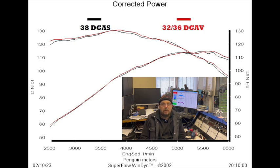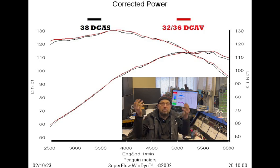Now, okay, some of you will go, oh, well, the engine needs a higher spec. It doesn't really make much difference anyway, because I've done this test on 140 horsepower engines and the difference was about one. So it isn't there. And some of you are going, yes, well, the engine can't make use of more carburation. Well, it can. Because in the next video, I'm going to show you this engine in the same spec, run on a pair of 40 DCOE series, and we pick up about 6 horsepower. So it's not that the engine can't make more horsepower with more carburation, it's just that between the 38 DGAS and the 32-36, the difference is bugger all.